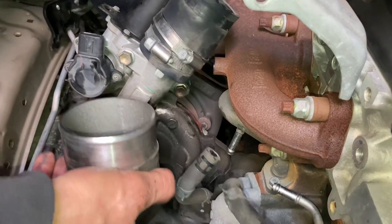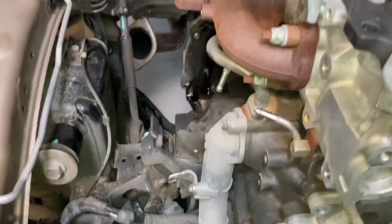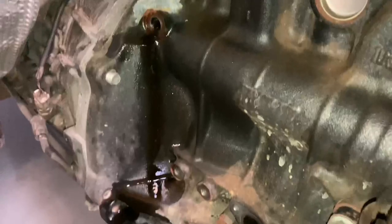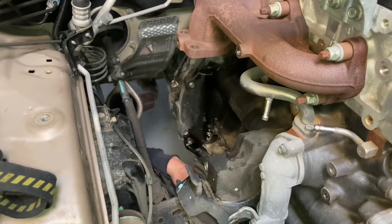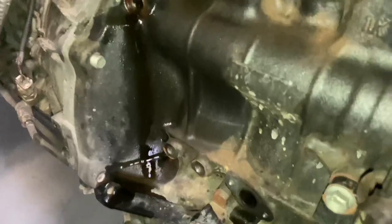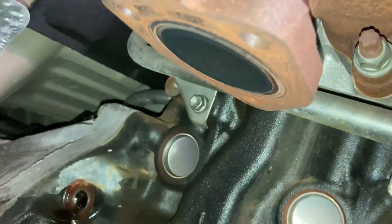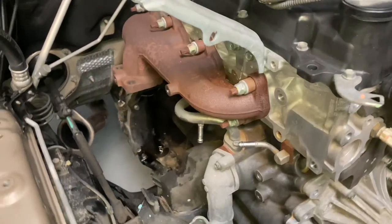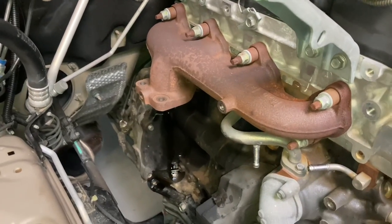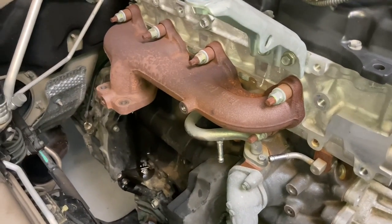Now it comes to the turbo — look at that. It's a bit tight; it only just fits out. So if you think you need a turbo and you're doing a BFE with a few things out of the way, it makes it a little bit easier and more accessible. You're going to get some things leaking out — make sure you've got no blockages or debris. There can be reasons why turbos fail, so you need to check all the oil pipes, coolant pipes, inlets, outlets, and make sure everything is working to a satisfactory level. That's what it looks like with the turbo not there — have a good look around.